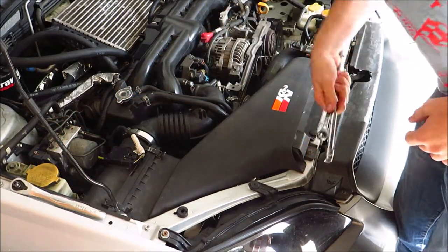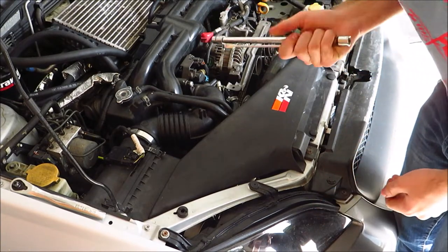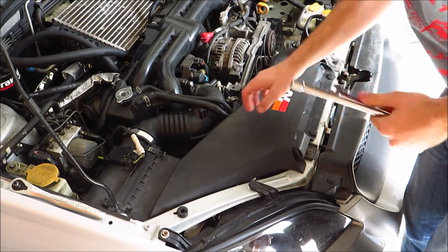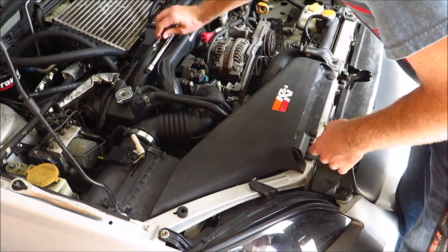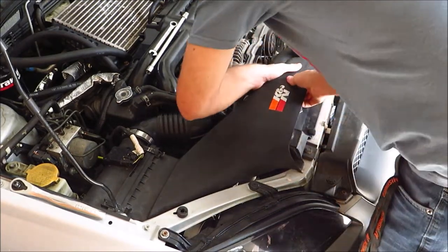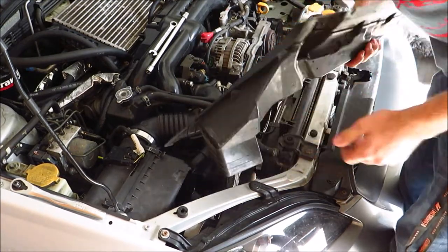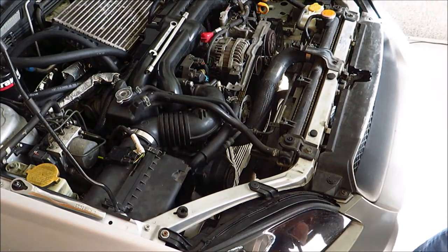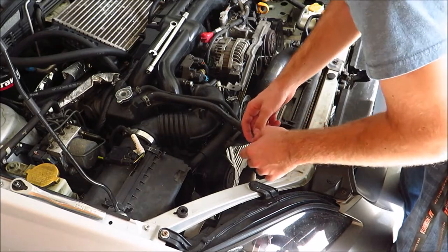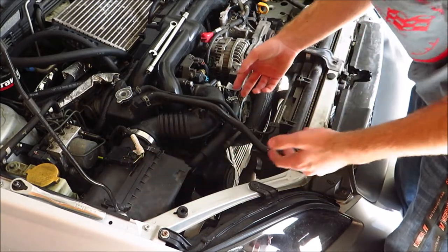I had to go out this weekend to get the car smogged and drove probably 320 miles — a little bit of a road trip. Not a good idea to drive that much with a misfiring car, but it only misfired at idle. I filled up with new good gas and the car stopped misfiring almost entirely. It's still an issue a little bit here, so I figure I might as well run another compression test just to see if it changed.